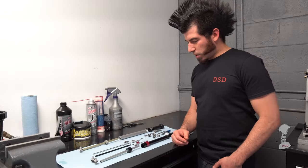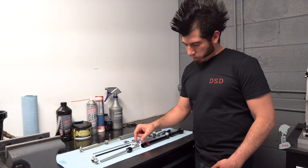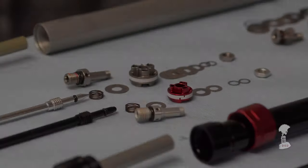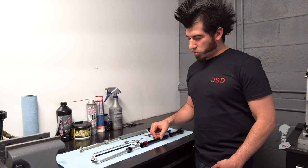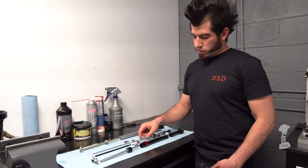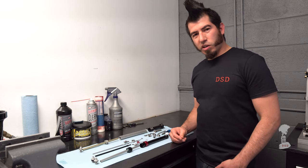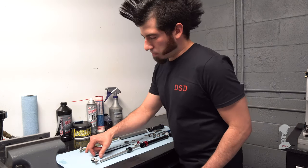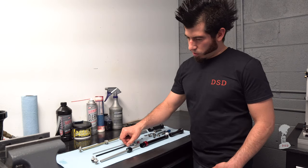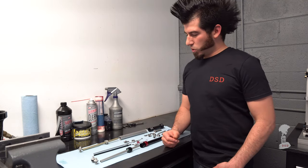The next challenge we had with Charger 2 was with rebound. They went to a much smaller piston and damper tube, which saves weight but reduces the amount of oil flow through the piston. Even after fitting the appropriate rebound stack for the rider, it was really easy to get stuck in between clicks because the adjuster thread pitch stayed the same — and even though they changed the needle slightly, you could still get stuck between clicks.